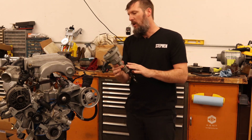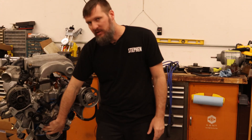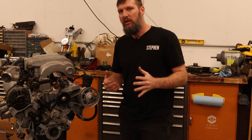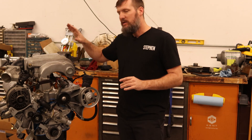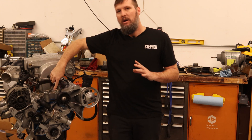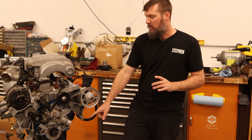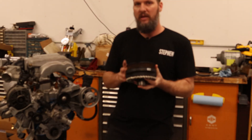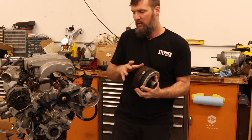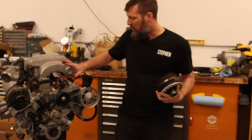In order to get rid of the distributor, we actually need to put a couple of components onto the engine. First, we need to know the position of the crank, so we'll have a crank position sensor down here. This is actually one straight off of a Ford Explorer. The late 90s and early 2000s Ford Explorer had a small block Ford with distributorless ignition. So a lot of those components you can take from that engine and put straight into the Mustang. I have the timing cover from the Explorer that has the bolt pattern to mount the crank position sensor. But you can't use the Explorer's dampener with the trigger wheel — it is a little different from the Mustang. The spacing of the pulleys are different between the Explorer and the Mustang, so if you put the Explorer timing cover on, it is too far in for your alternator, power steering, water pump, and all that stuff.